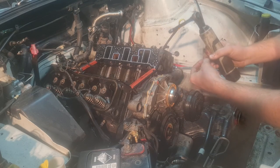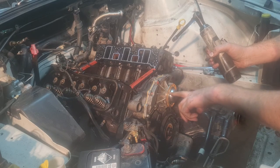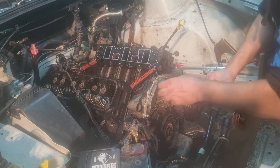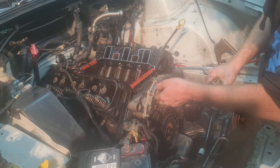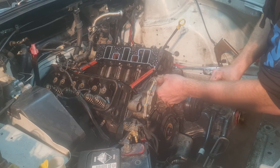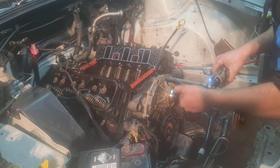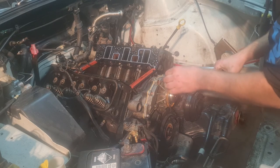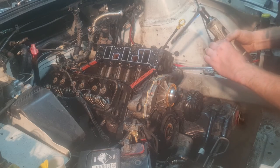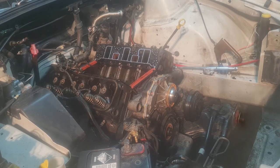Now on my part, you might be seeing a fair bit of sealant come out of it. That was because some of these bolts go directly into the water jacket of the water pump and the housing. That was honestly just to make sure that I covered any possible water leaks. Seems like it worked, because I haven't seen any water come out of it.